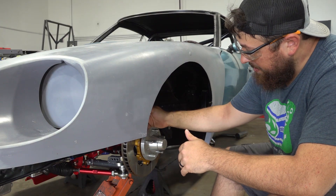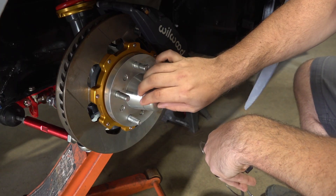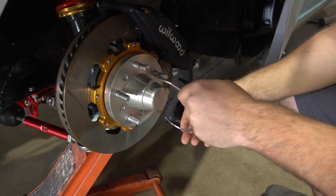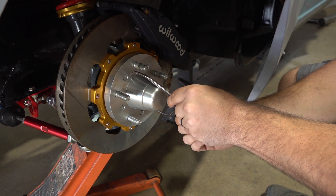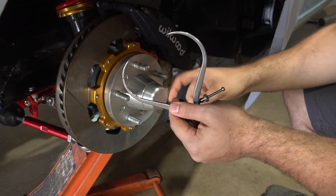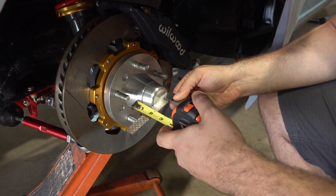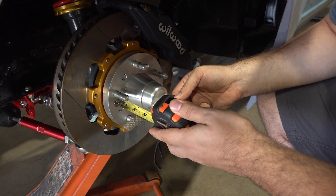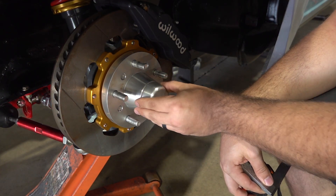The main things you really want to figure out are how much clearance you have inboard, how much clearance you have outboard, how much clearance you need for the brakes, and how much clearance you need for the hubs. Because of how large this hub is, it's pretty difficult to get an accurate dimension of the diameter. I found that placing this tool over the hub and dialing it down to just barely clearing gives you the hub diameter, so the center bore of the wheel we have made will fit nice and snugly. To measure the protrusion of the hub, I'm putting a straight edge against the hub and a tape measure right against the actual mating surface of the wheel — that gives us our hub protrusion so the wheel manufacturer knows how big the center cap needs to be.